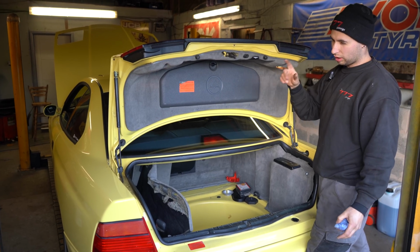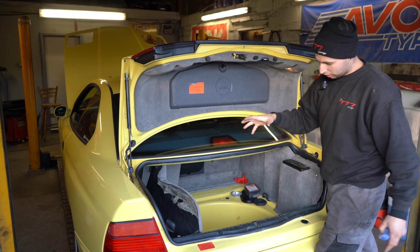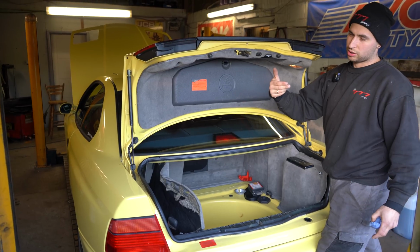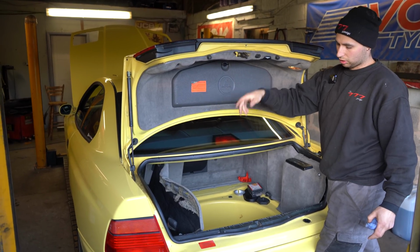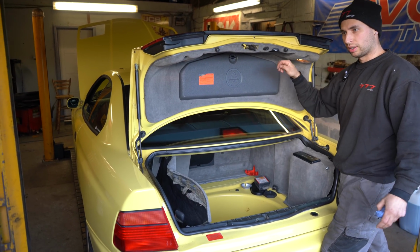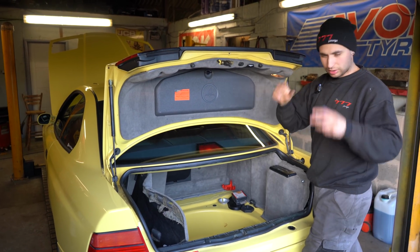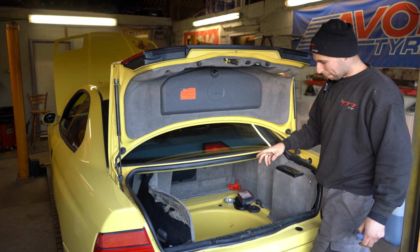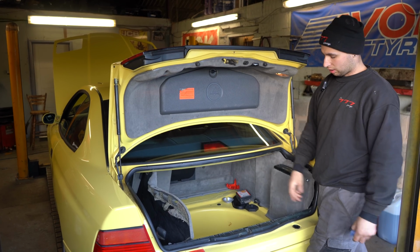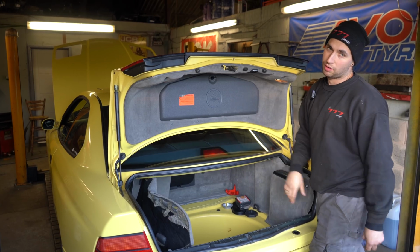So as you know, if you've got headlight washers, that means you've got the main tank in the boot. Then when you pull the stalk, the pump pumps from here to the front. There is another motor at the front which pumps to the windscreen. It's complicated, but it is what it is. So what happened was the pump was seized, blew the fuse, and that's that. So I replaced the pump, found that the fuse was broken, and now everything works.